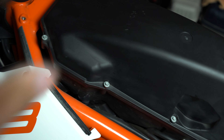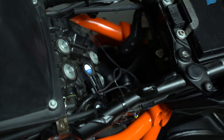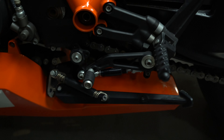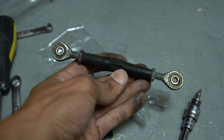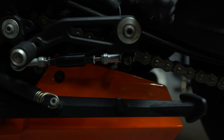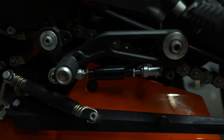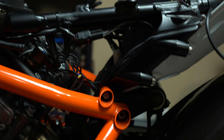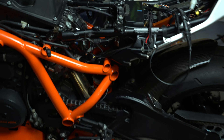Progress has been made. I got the cover back on the air box — I found a little spot where I was able to get the wires connected without removing the air box. It looks a little messy right now but we'll clean that up once we test everything. I got the actuator on. The rod that came with the kit was 50mm and didn't match up with the stock one, so I used the actuator and the heim joints — same length I needed. I ran the cable up and got the module placed in the box area. I'll clean all the wires up and test everything.